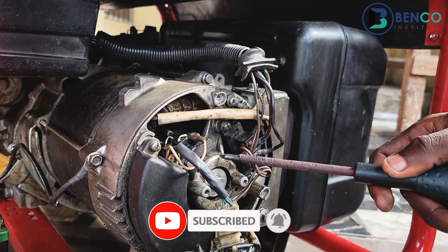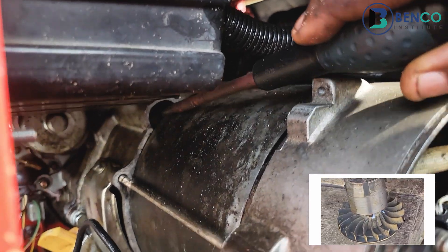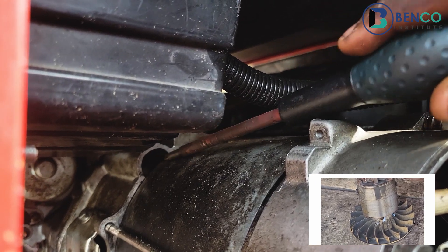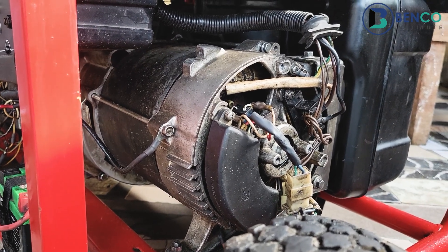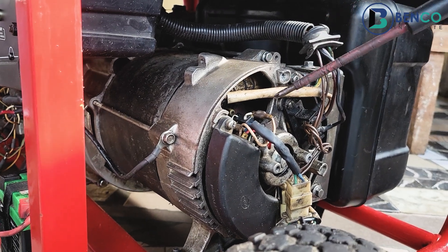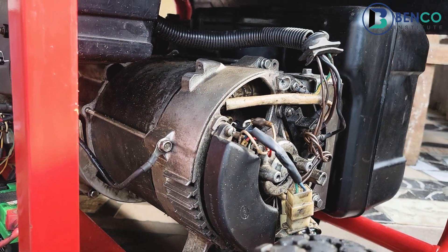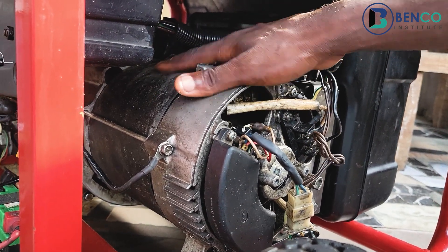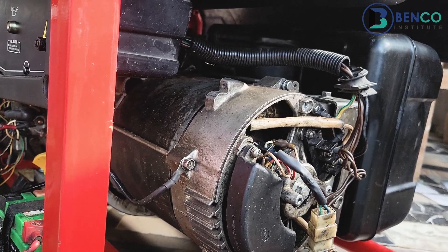The next component is responsible for ventilation — this is what we call the alternator fan. The alternator fan is hidden at the base of the alternator. As the rotor rotates, the alternator fan rotates with it, giving the alternator sufficient ventilation. When it rotates and works for hours, it is bound to dissipate heat — everywhere is bound to be hot. The function of that fan is basically to dissipate heat.